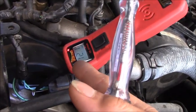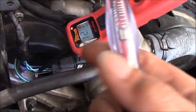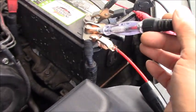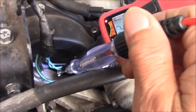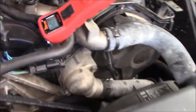You know, in some cases we have this tool telling you power, or the multimeter telling you power, 12 volt something, battery voltage, but don't believe it, because sometimes the component is low and we get a voltage drop. Right now I connect the test light to the negative to check for the power and check your connection. Yep, I have power now. That means we have a good connection right there. Okay, touching there. Yep. We don't have the voltage drop on this power wire.